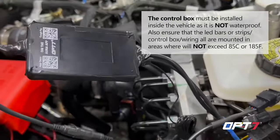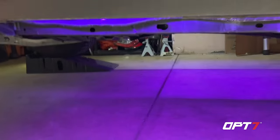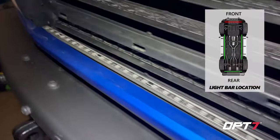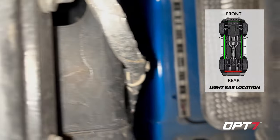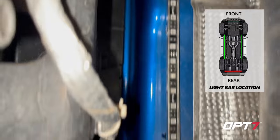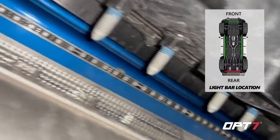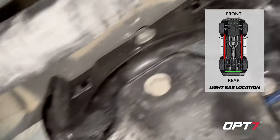Now that we've got it all connected, moment of truth — we turn on aux four and there it is. The Badlands has a really big skid plate up front, so we couldn't put the light strip underneath it without exposing it to rocks or terrain. Instead we put it underneath the grille shining up on the radiator. At the back, above the muffler, we used two-part epoxy to glue neodymium magnets to the back of the light strips — the magnets hold the strips onto the body without drilling holes. You can get them at Home Depot in packs of six, really cheap. The side strips we put in between the rock rails and the frame.